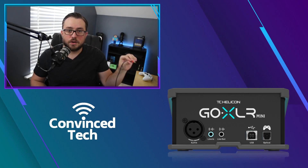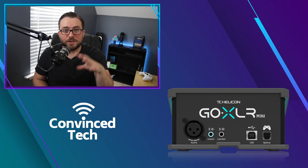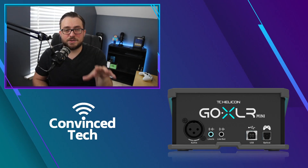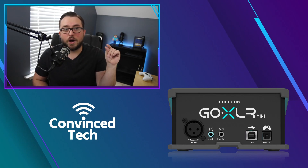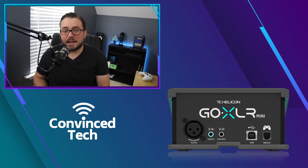This cable goes from the line out of the GoXLR Mini into an input on your second PC. This sends all the sounds from the main computer over to your streaming PC. On the streaming PC you'll only need to use that one input for sound, because all the mixing is done either directly on the GoXLR or inside your main computer — you only control the overall volume on the streaming PC.